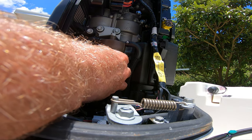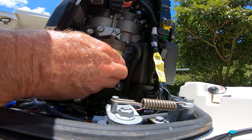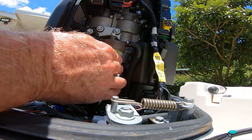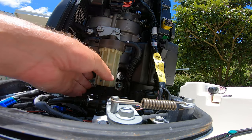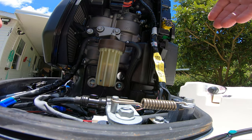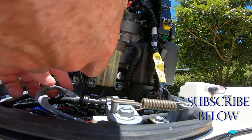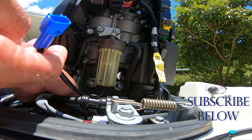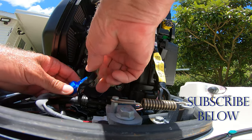Didn't see anything wrong with it — it's a brand new engine so it shouldn't be an issue. Just tighten that back on there, real easy. This is a great time, every time you take your cowling off, to inspect your engine — give it a visual eyeball, walk around. Good time to shoot a little bit of oil on your fittings, check everything, check your engine oil. If you have corrosion block spray, spray that in there. Just make sure that sensor is plugged back in.